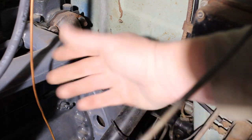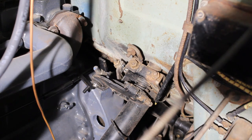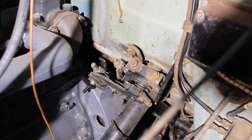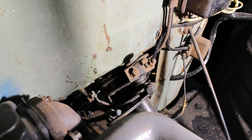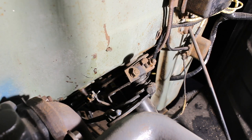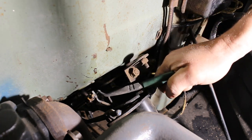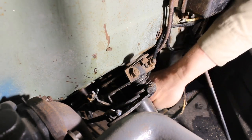I was going to show you what pulling in neutral — pulling towards the steering wheel to get to first or reverse — does here. So this is just pulling straight back, and this is going down to first. If your measurement inside between the wheel and the lever is still off, don't worry — mine just happened to fall right into place, but we're still going to take care of you. What I want to do is get the cotter pin and washer off right here on the selector rod.